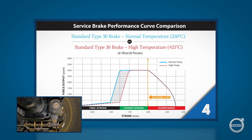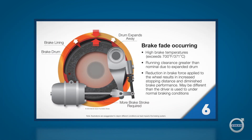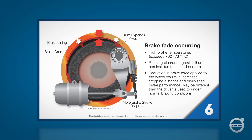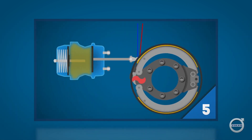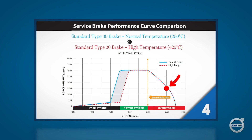If the brake adjuster is properly adjusted, the pushrod and the adjuster should be at a 90-degree angle. But in the case of a hot brake drum — as when making a steady brake application on a long downgrade — the drum expands and the pushrod travels out further beyond its adjustment limit. You can see on the chart that as the stroke continues from two inches out to two and a half inches and beyond, the force exerted by the pushrod against the slack adjuster diminishes. At two and a half inches, the force is just 1,500 pounds — down from 3,000 pounds at its optimum stroke length. The brake at that point is producing about half of its potential stopping power.